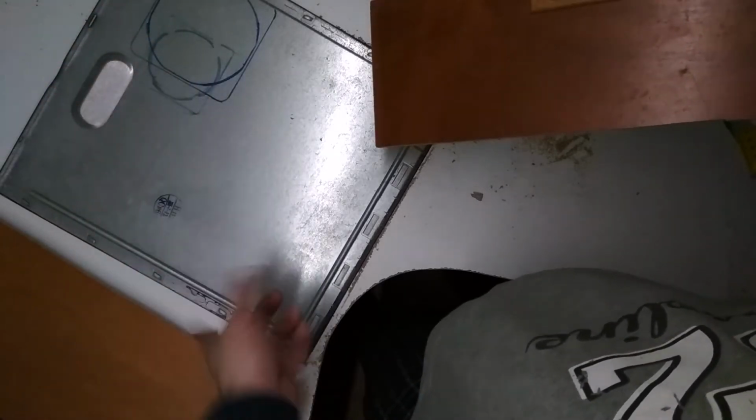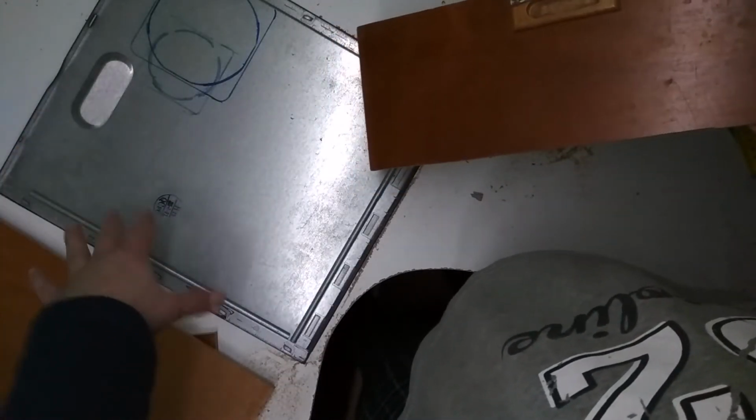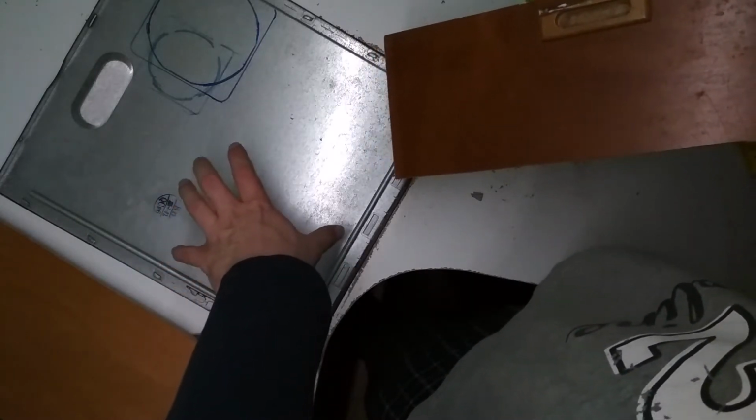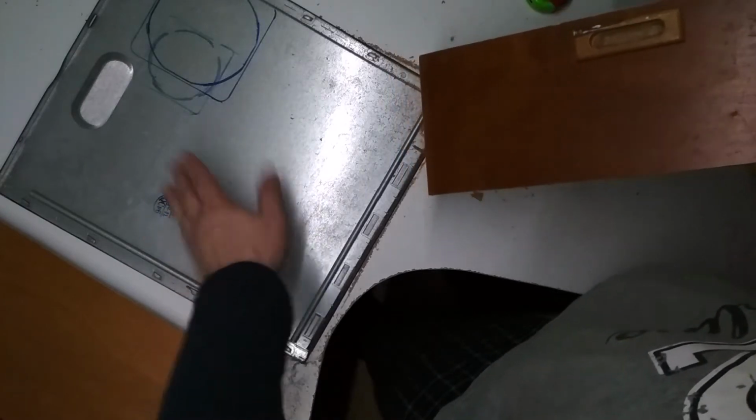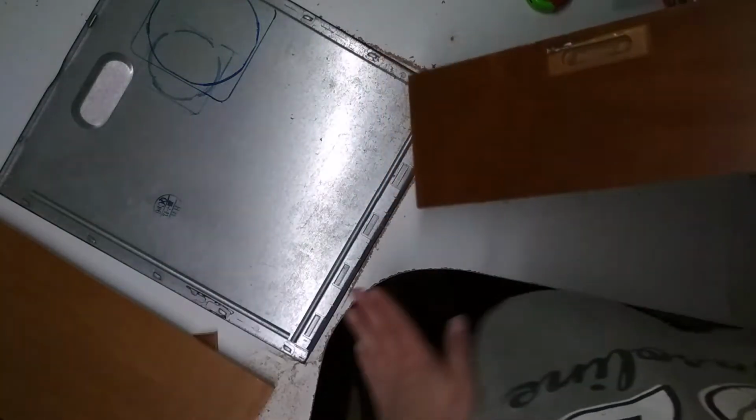I can't do anything about it. I don't want to put it on top where all the heat is, because in a vertical case the top is always the hottest, and that's not good for a power supply. I want the top to be mostly empty, so every major component will be here, the processor, the video card, power supply, and then all the hot air can escape and cool air comes in from under.